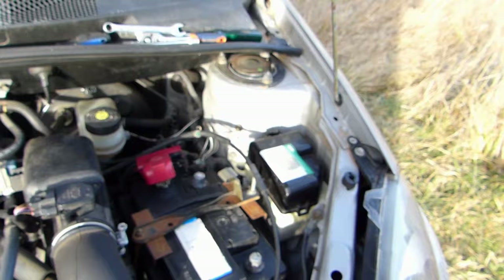Moment of truth. Well, central locking works — that's already a good thing, it didn't work with the blown fuse. Yes, all the lights are on. Ventilation works. And here she goes. So good news! Knowing that I have a 100 amp fuse in and the fuse is supposed to be 120, I'm going to be a bit careful with what I use in the car. Since this one doesn't have aircon already, that's something that's not going to need too much electricity — so I should be fine.